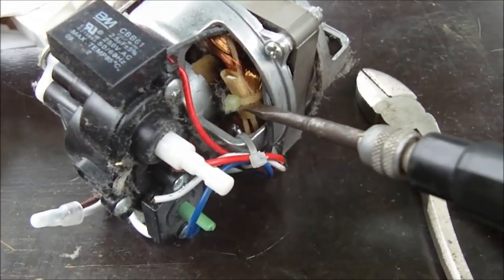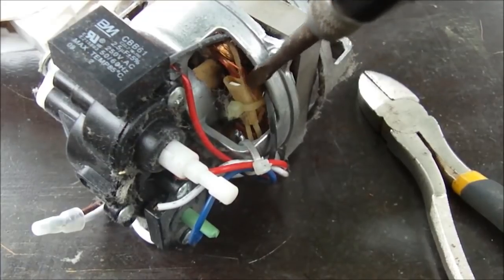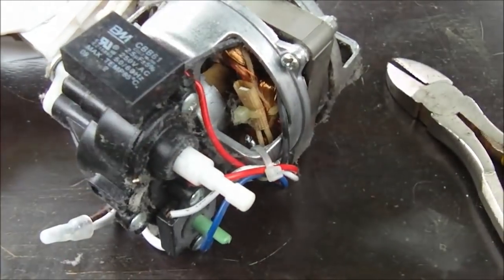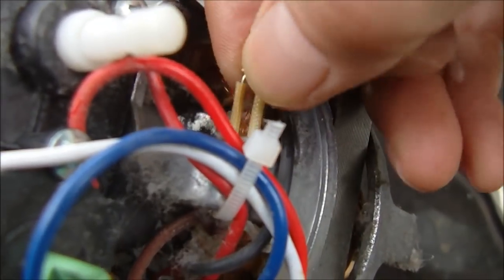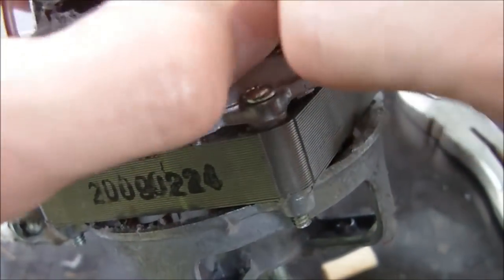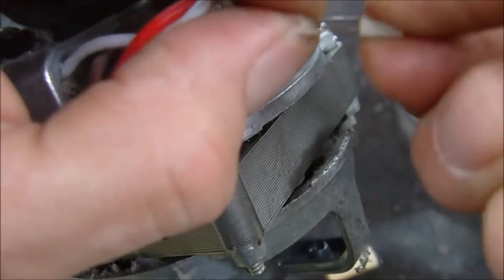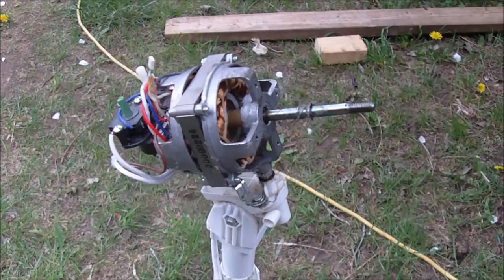See here there's this little thing with a little insulator over it and two wires coming out, basically wire-tied to the coils. That is our thermal protector — it's rated 115 degrees Celsius. So what I'm going to do is cut that off to get it out of there. I'm going to attach the two wires together by twisting them, hook this motor back up very carefully, plug it in, and see if the fan will turn on. That will tell me if it's the thermal protector.